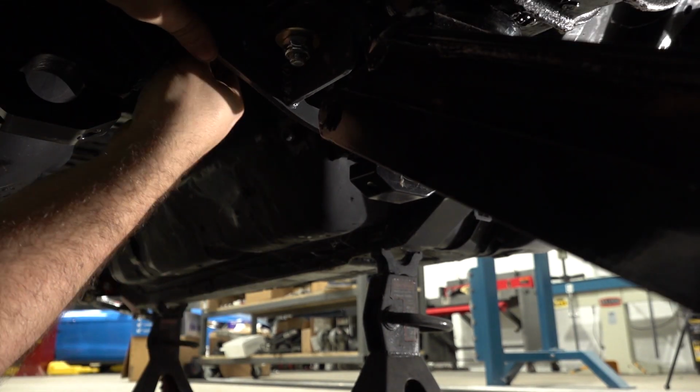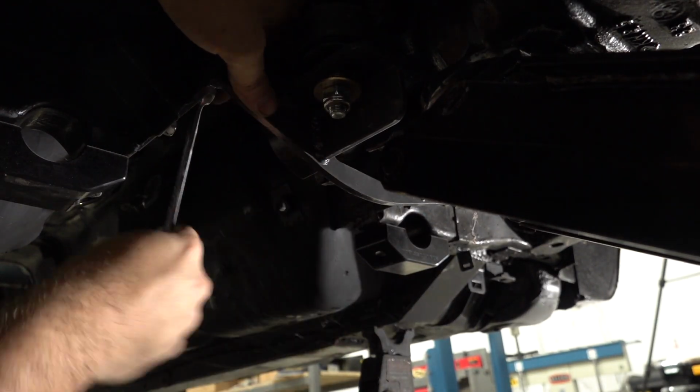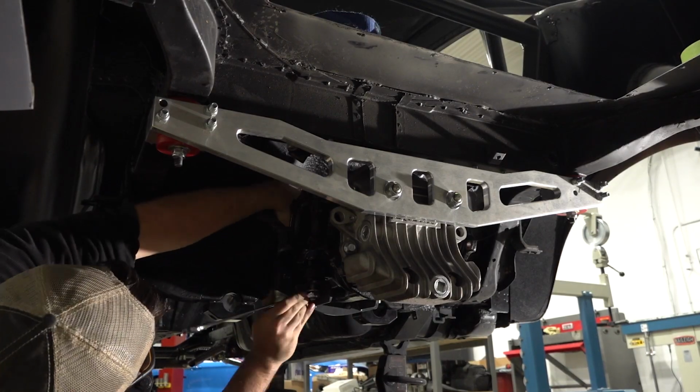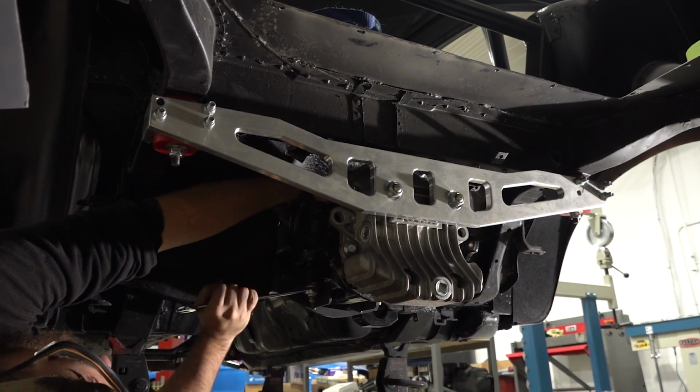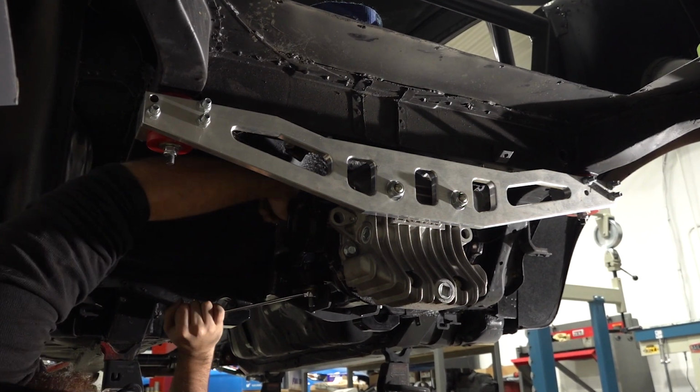For the rear of the car, I'm using Techno Toy Tuning's complete R200 short nose conversion kit for S30s. This kit helps me eliminate the factory stub shafts and instead use shortened, beefed up Q45 6x1 axles and the Nissan GTR differential.